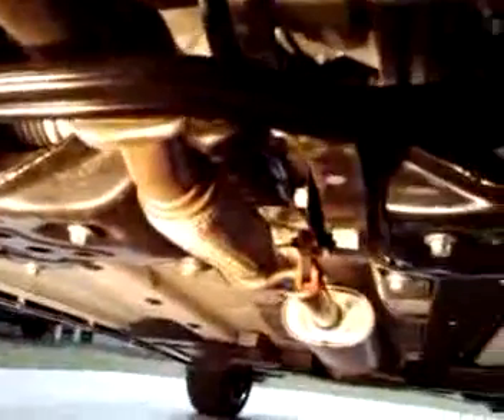One of the most common things people look for underneath is the drain plug — there it is, nice and accessible. No problem with changing oil on a Fiat 500. Moving across, you can see where the subframe connects into the transmission. There's a coupler right there that can actually pivot. You'll also see the CV drives right on top of that, running over to the front suspension.